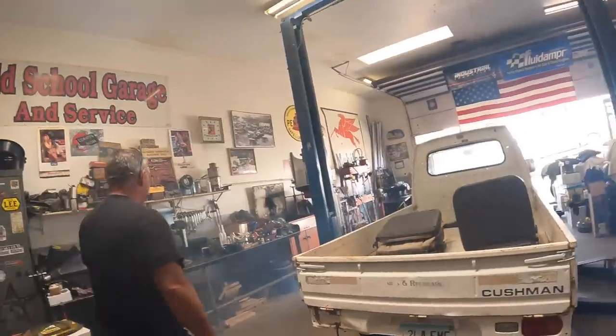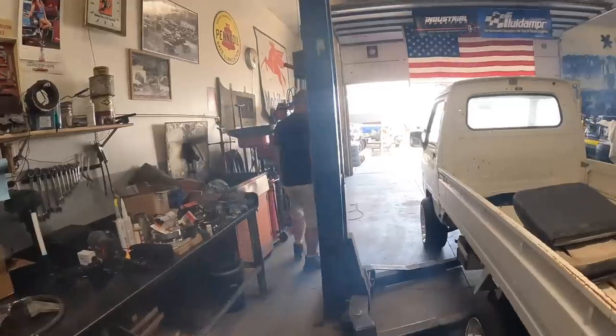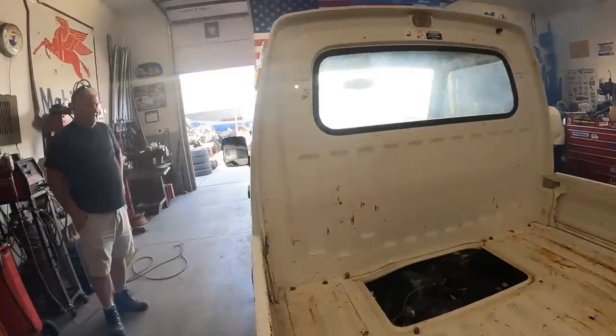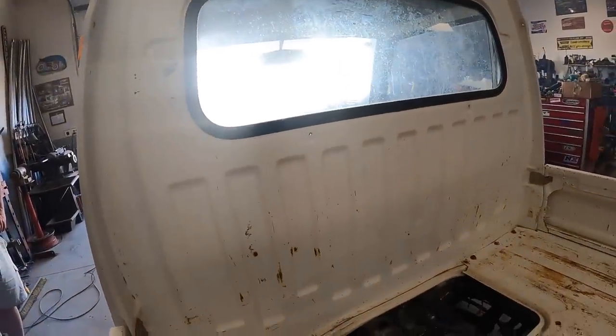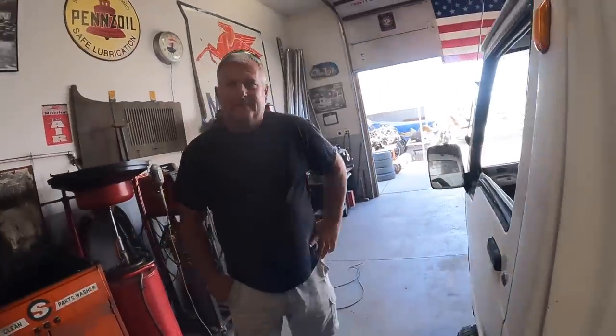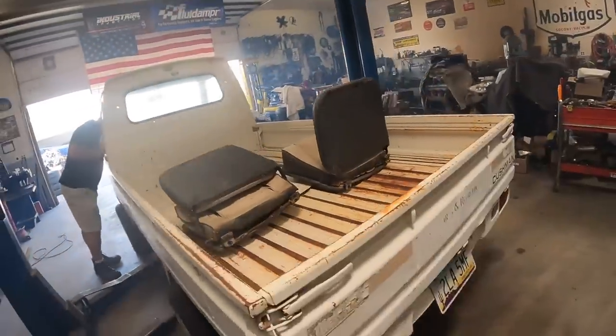After really looking the motor over, there's no way we could turbo it. No? Dude, the pistons are like... I think lawnmowers are heavier duty. Oh, really? I'm afraid that it'll break a skirt and shatter a piston. But I think if we mess around with this carburetor, it sounds like it's going to run pretty good. Sounds freaking amazing. We'll get some upholstery in it and a steering wheel on it, and we'll be out doing burnouts later today.